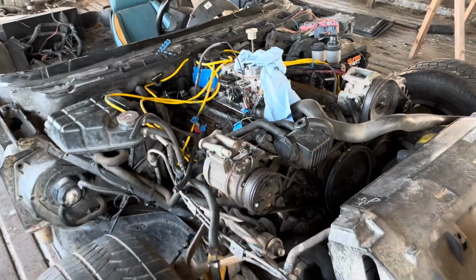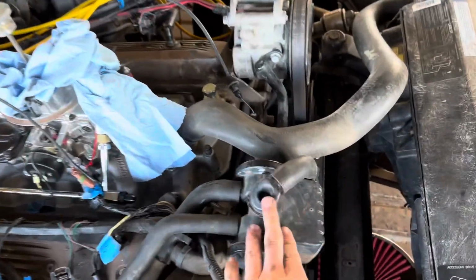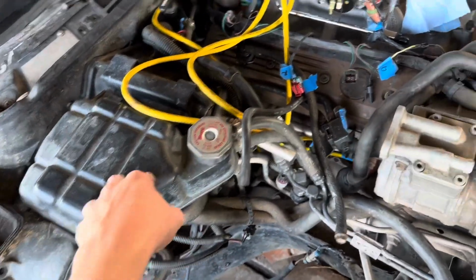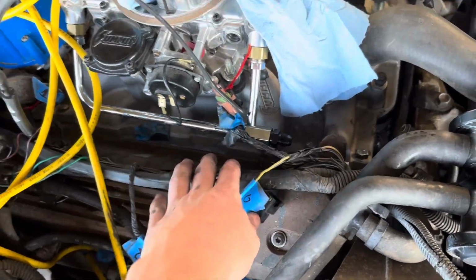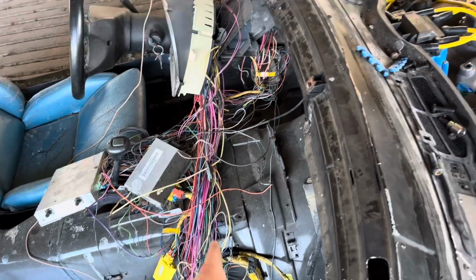All right, so because that was quicker than I thought, I'm gonna keep going and stripping some stuff up here. So there's a lot of stuff up here that can go. Anything EGR or emissions related, anything AC related like this. A lot of our wires now that we've gone carbureted, a lot of these can be removed, which will then lead to us being able to remove these. I'm not sure if that'll be today or the next video, but that's definitely a possibility.